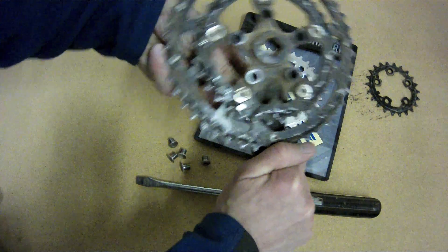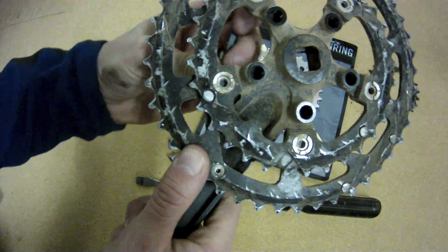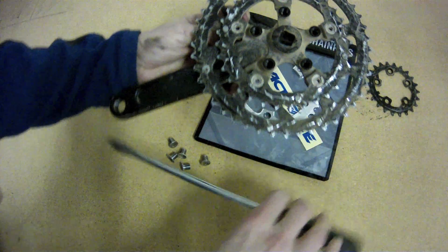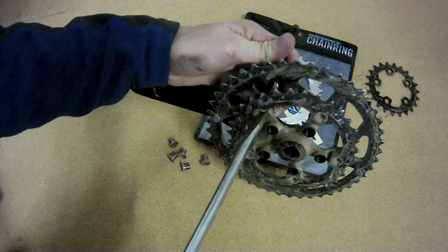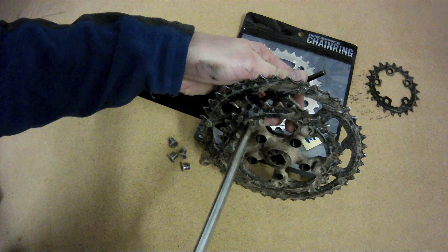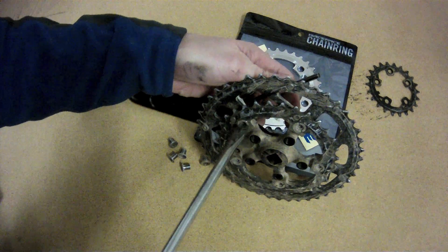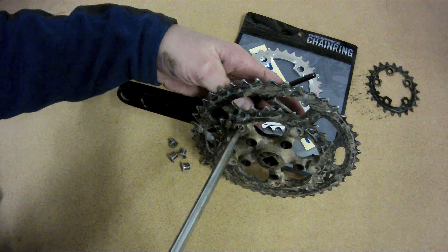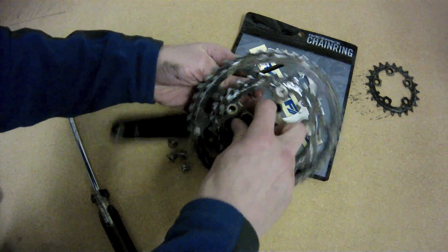As you can see here, even though it's loose, it's turning the other side as well. So that's where you grab your big flathead screwdriver — you'll need a really big one to get across the chainring bolt from one side to the other, so you can really get into that flat. Then you can either turn the screwdriver or turn the Allen wrench to screw it out, and the chainring bolt comes apart from each side — you pull one half off the front and one half off the back.